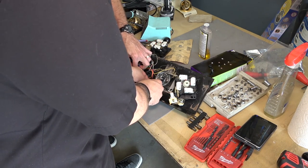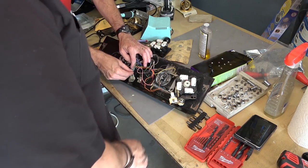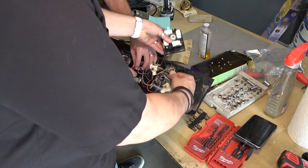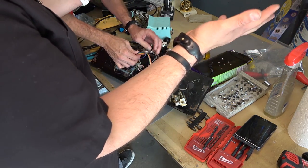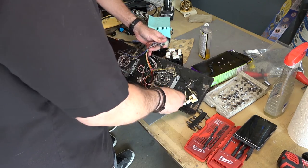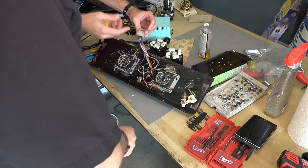So it's like normally closed or normally open, exactly. And we're using the 2 outside ones, which is normally open. Meaning that when it's not engaged, it's open and there's no connection. And when it's normally closed, it's always closed, and then when you engage it, every single one of these signals goes to the game board.